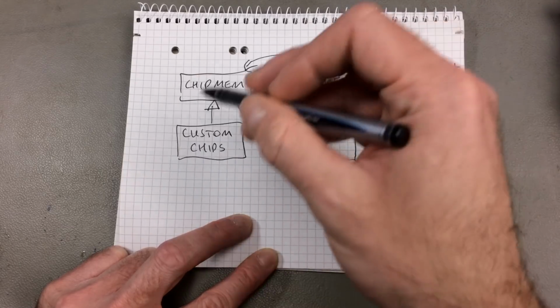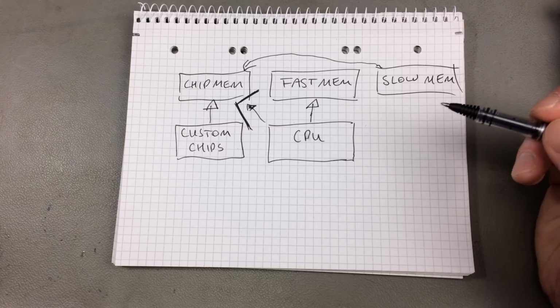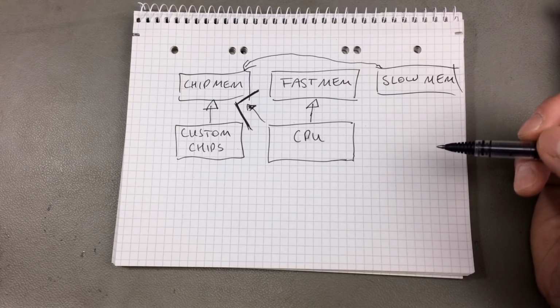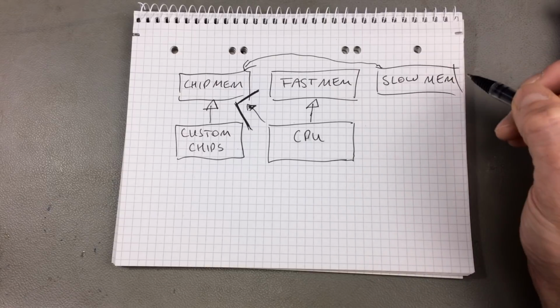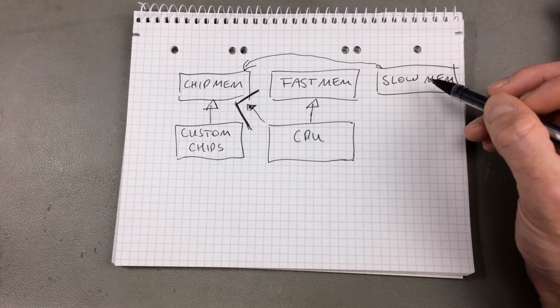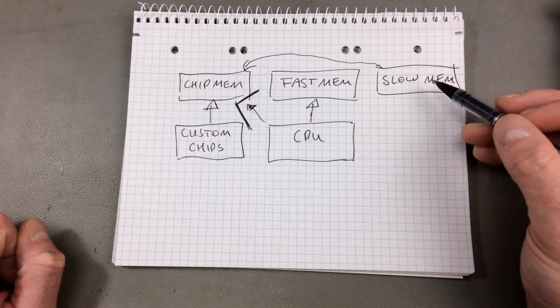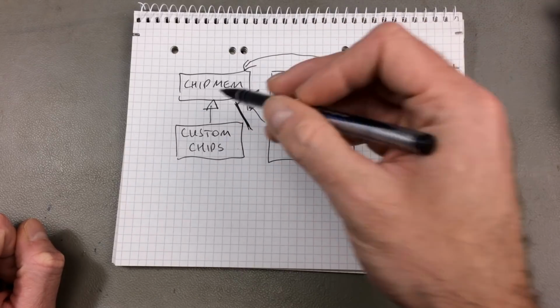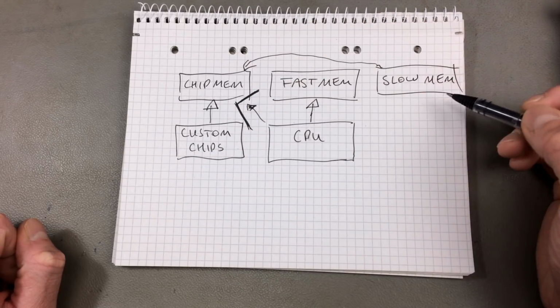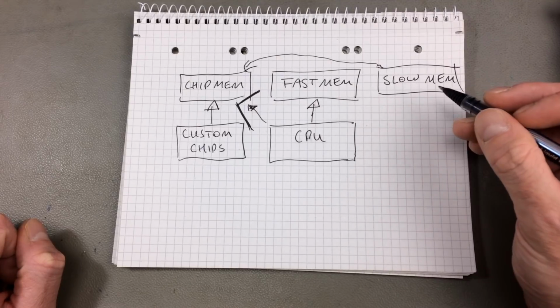So that's basically what the two, or maybe if you want three, sorts of memory the Amiga has are. This is kind of what an expanded Amiga 500 or an unexpanded Amiga 2000, like in my case, has. This is the fast mem that shares a bus with the chip mem, so it can be slow. And it is counted as slow mem in some software as well.